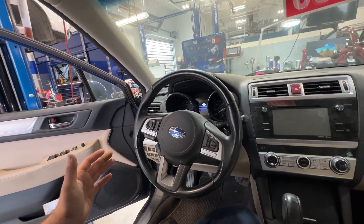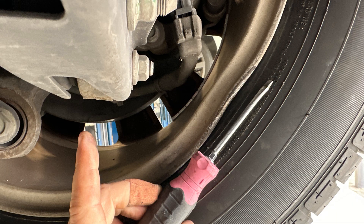I only have a still photo of my undercarriage inspection — I forgot to hit record, that's my fault. But we found two bent rims, and all four tires had excessive wheel weight. The excessive wheel weight was because the shop did not remove the old wheel weights — they just added more. You can't do that; even if the tire balances out, excessive wheel weight will cause a vibration. Of the two tires I rebalanced, I checked inside them for water and found about half a cup in one of them, proving the installer was really sloppy with the soap and water.